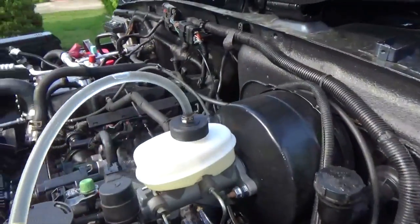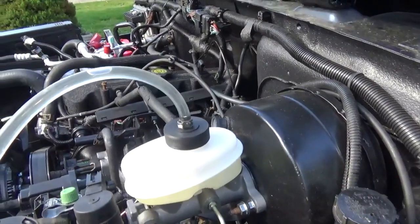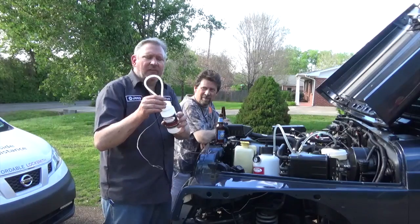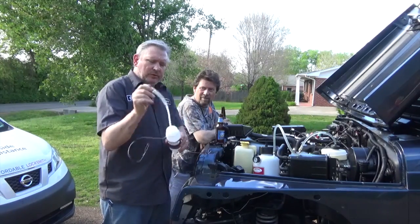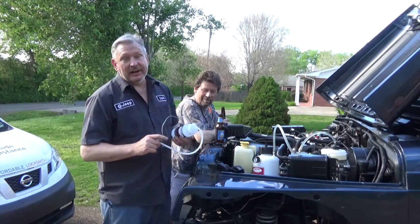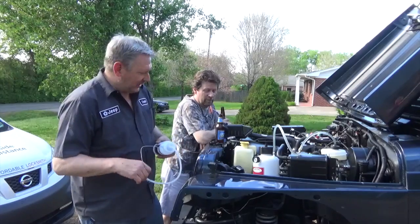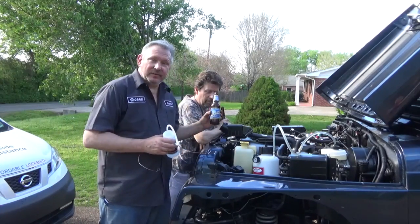This is full of brake fluid and you can see the air coming out from the master cylinder — how cool is that! While I was at it, I went ahead and bought a power bleeder recovery unit, which is basically a jug with a wire on it and a hose. That goes on the end of your bleeder screw so you can capture the fluid and pour it back in. It keeps it from going all over your driveway like when I didn't have those two lines hooked up correctly. And it always works better with a Blue Moon.